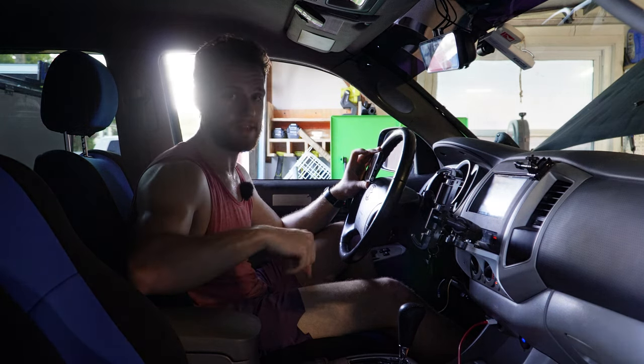Now, to help you easily find the transmission overflow plug, we are on our passenger side. Come down here on your creeper. Say passenger side, and you're gonna follow that to right here. That's your overflow plug. So you wanna make sure you grab a pick, and you're gonna clean this out and make sure there's nothing in there, because it is a 5mm hex, and you want that thing to sit perfectly. Truck is running, AT temp light is on. We're gonna come down here and undo our overflow.